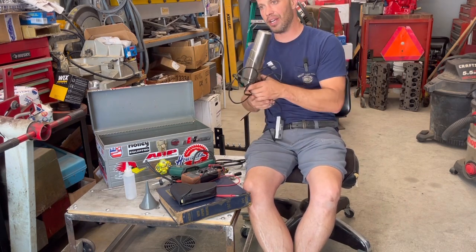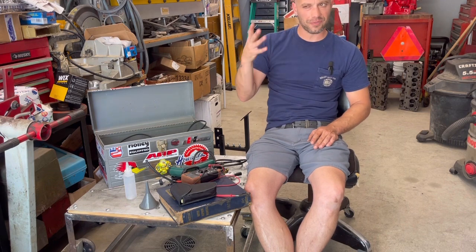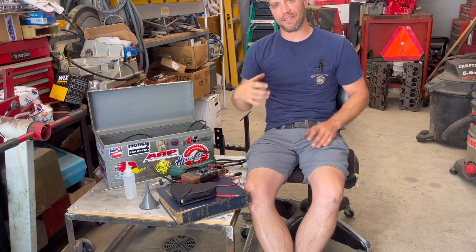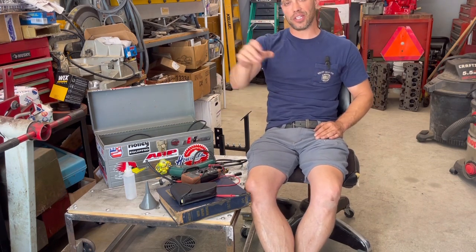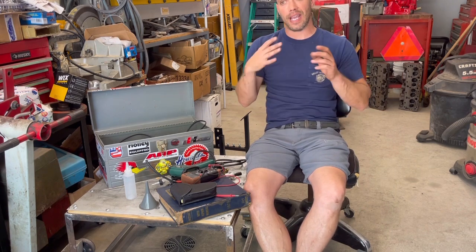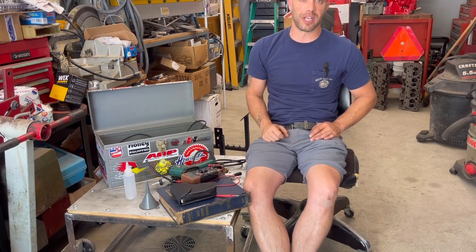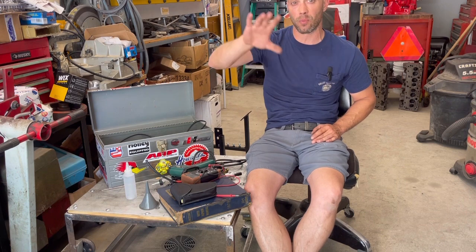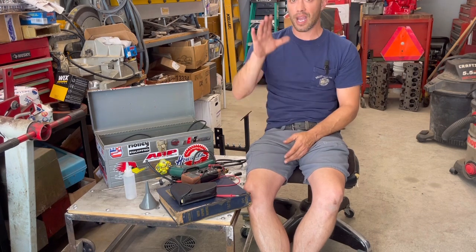Last but not least — a timing light. When you build an engine initially and put it in, you're not going to exactly know where the timing is when you drop that distributor. Jimmy and I know from building engines — with his millions of years of experience and thousands of engines built, he knows where to kind of put that to get it fired. We're turning that thing, listening by ear to see where it's happy. From there we'll check the timing, set it, break it in, and go from there. After a shutoff we'll fire it back up and advance the timing a little bit to see how happy it gets before it starts kicking back on the starter. You can do a lot of tuning on this even though it's not a dyno — this thing here is like its own science lab. I'm glad we built it.